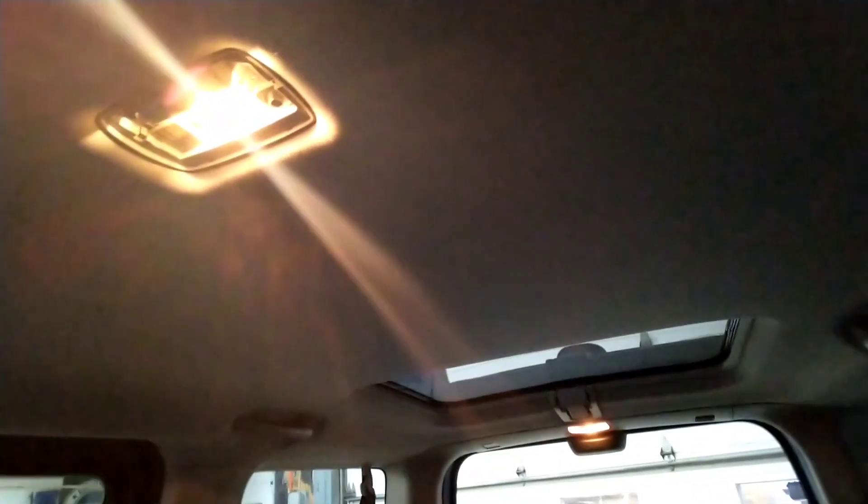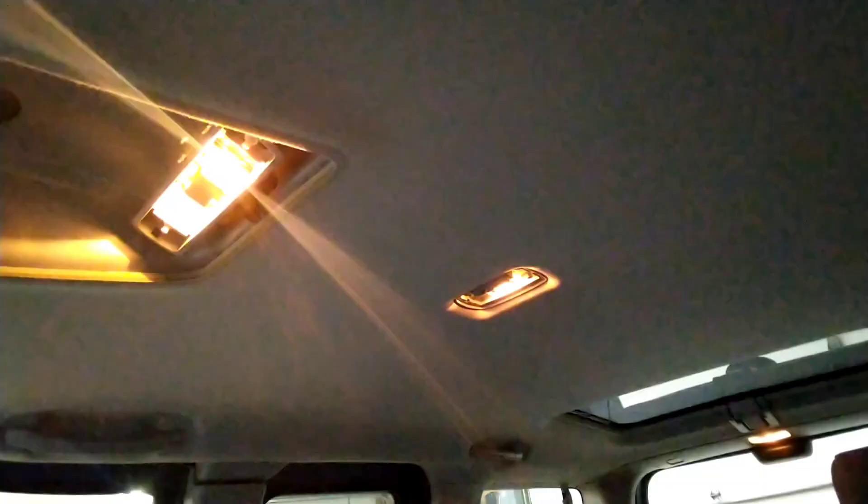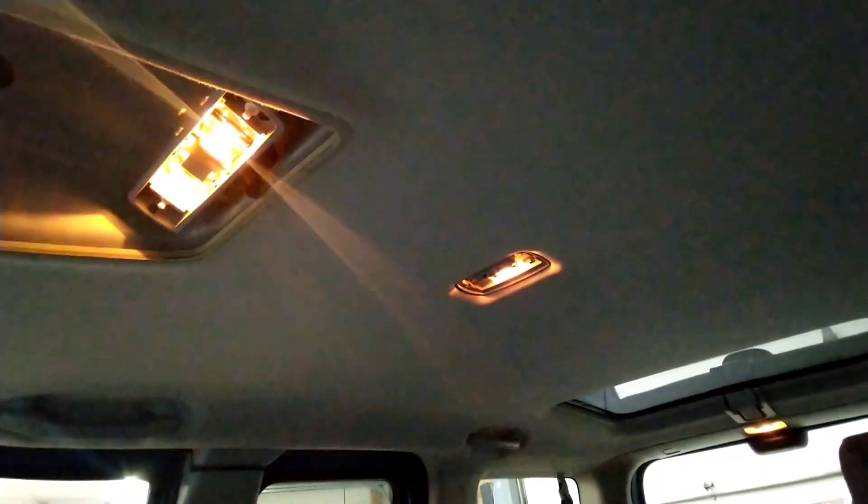that still works as individual clicking map lights. But with this little jumper set from these bulbs back to the trigger wire for the front light, when I open my door here, you can see they all turn on now. If I close it, you'll see them get dim. We fast forwarded just a little because it takes a while for these things to dim — there they go, all three out in unison.